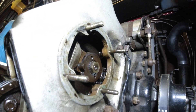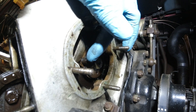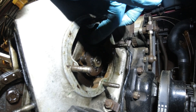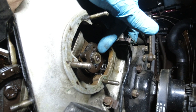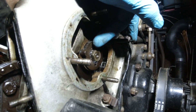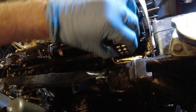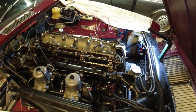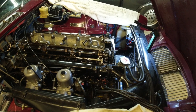Here's a closer look at the tensioner. Those are the two holes that the tool goes into. When you put the tool in, it pushes in this locking part here — they're usually a little bit stuck, you can tap them a little bit in. That moves it away from the teeth on the side and makes it so you can turn this thing backwards and forwards. First thing you need to do is loosen the lock nut here. I just stuff a bit of rag in here, loosen that one slightly, and then you can start turning the adjustment. Remember, it is counterclockwise to tighten, clockwise to loosen.